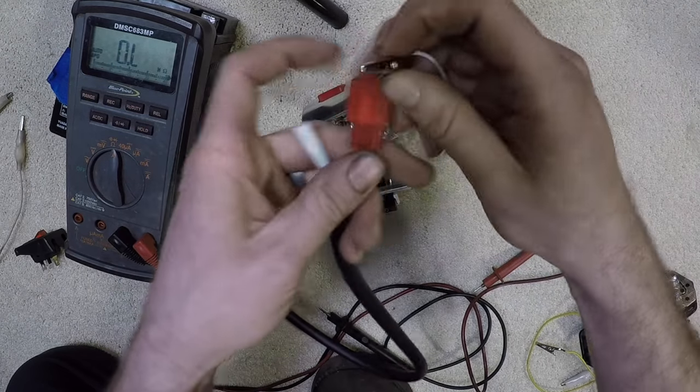Now when it comes to starter buttons and kill switches, you've got to use common sense. What is the purpose of the switch? For most bikes — most Hondas — the kill switch cuts power to the coils. It cuts ignition. That's the kill switch's goal. To cut power — it does not cut the headlight, it does not cut the brake light system. A lot of Hondas use the starter switch to actually cut power to the headlight to allow for more voltage to be used in the electrical system — go to the coils, go to the starter solenoid, go to the starter. It's a pretty intelligent design.